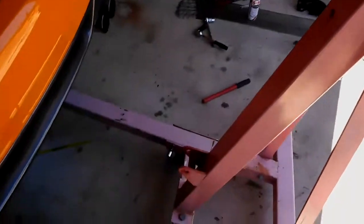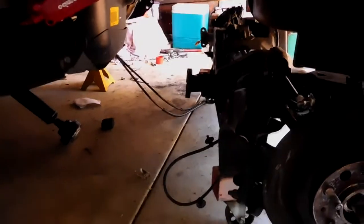Little life hack for any of you guys going to do this - if you've got an engine crane, it works really well as a trolley. You might have noticed I had the cradle sitting on the legs of the engine stand out on the patio while I was working on it. What I did was take the cylinder and the lift arm off it, then just wheeled it straight under. I had about 10mm clearance each side but it just fits, so now I can wheel it almost all the way under and then I just need to figure out a way to get the jack under it so it's stable. I'm going to get a hand from Travis, my neighbour, to put it up there. It's getting close, it's all happening.